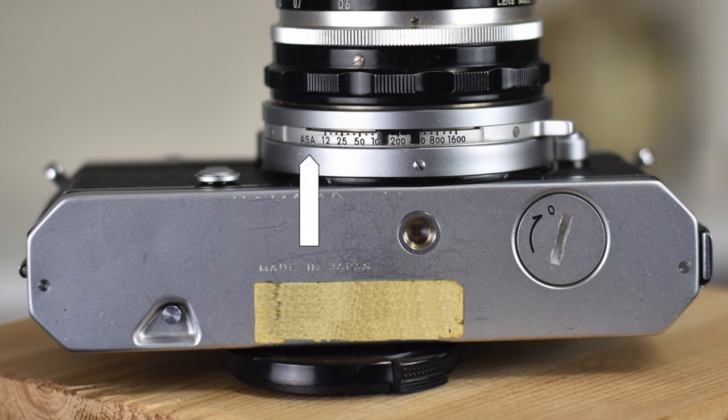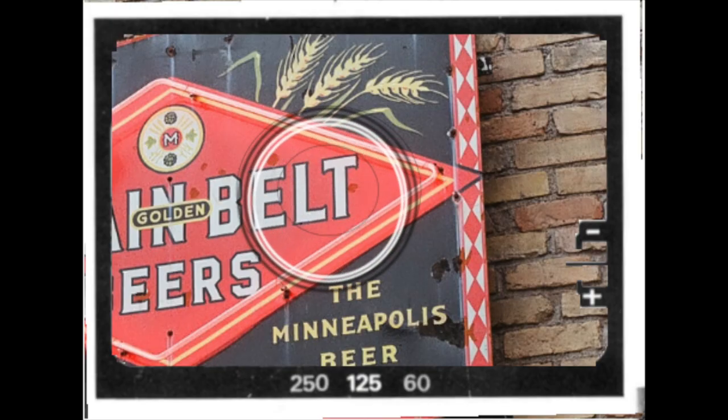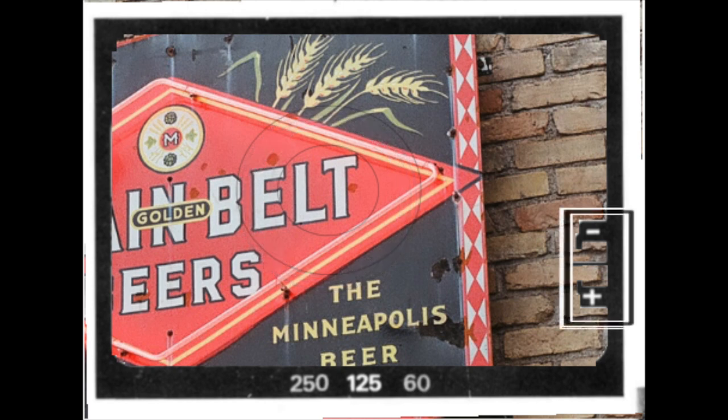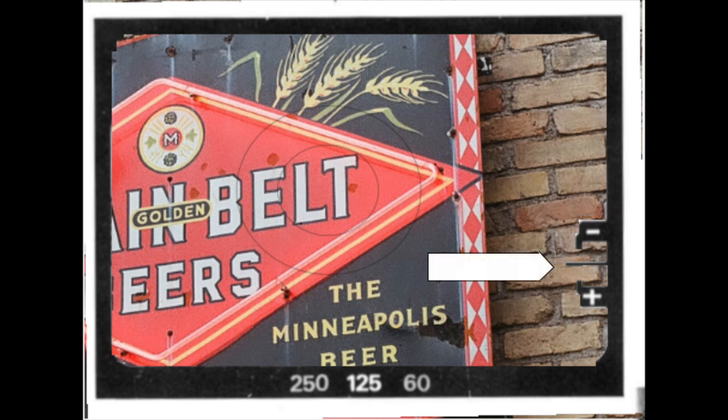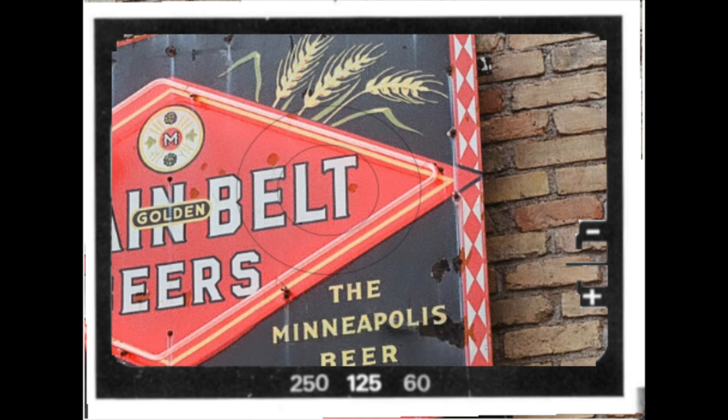From the bottom view, you can see that the bottom of the shutter speed adjusting collar is where you set the film speed. Looking in the viewfinder straight ahead, you see Nikon's 60-40 weighted metering system. To the right of that, you see the meter itself, which is a needle — you put the needle in the middle for proper exposure. At bottom center, you get to see the shutter speed setting. Unfortunately, you don't get to see the aperture setting in the viewfinder.